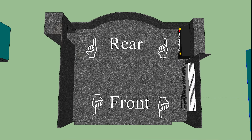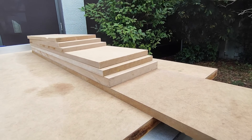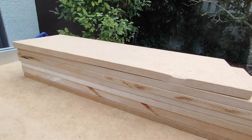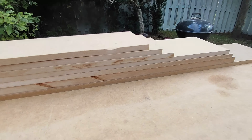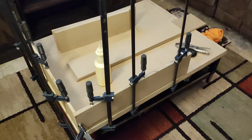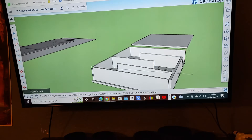Drop a comment below — would this be something you'd install in your trunk? Next up is wood selection. I decided to go with MDF for this build. Yes, MDF is heavy, but I like the density and the sound signature of it. You're looking at two different dimensions of MDF: half-inch and three-quarter-inch. The front baffle is going to be three-quarter-inch MDF, and all the internal walls of the enclosure will be half-inch MDF.